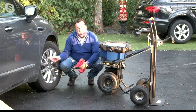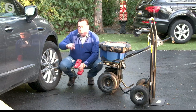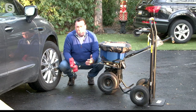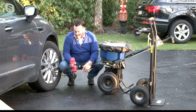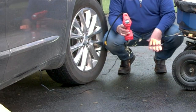I can check what PSI I need, turn this on, and set it. In this case I know it's 34. Also, a myth is that you can punch or kick a tire — maybe your dad or grandpa told you that when you were younger. That's not true. You have no idea what the air pressure is by looking at a tire. So what you do is set it, hold the trigger, and it will inflate to that perfect tire inflation.